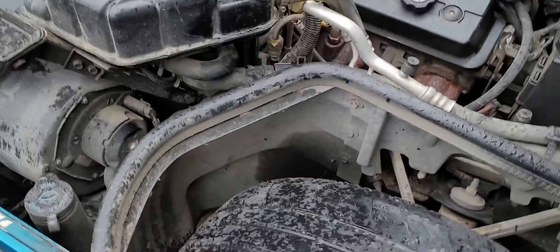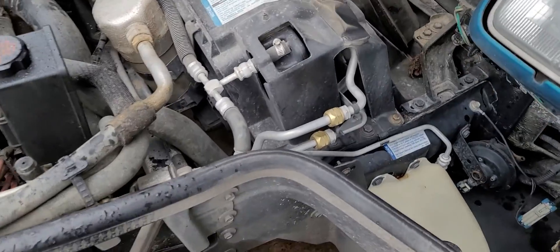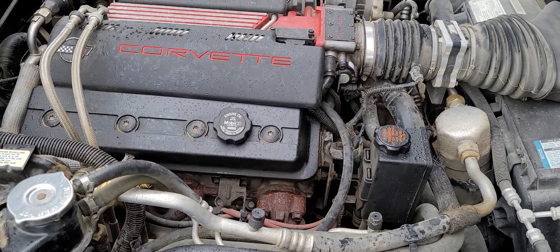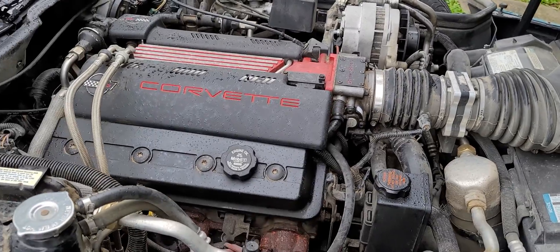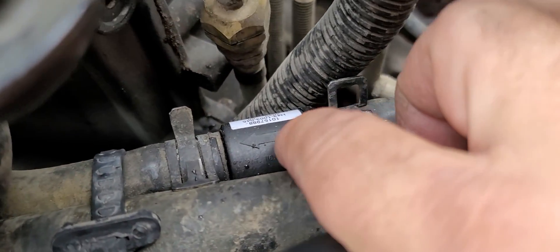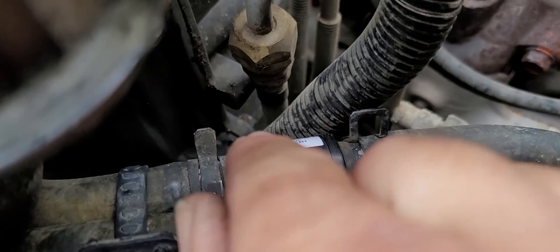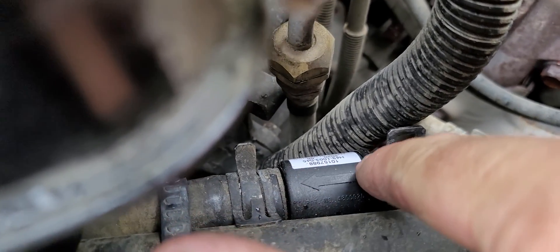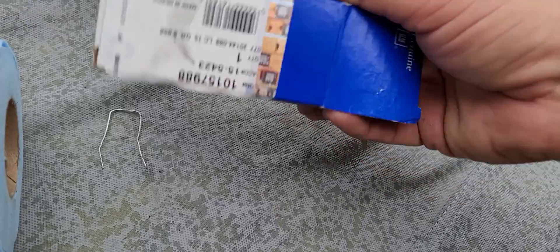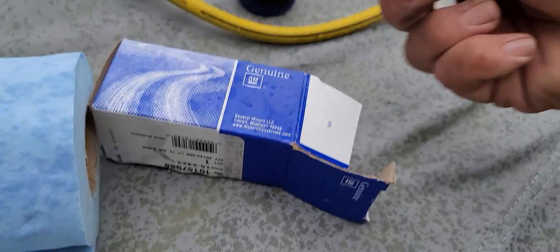I ended up on the cooling system today because I had a small failure. When we were running the car and it got up to temperature, we had a symptom where coolant was boiling. Sometimes that can be a head gasket issue, which obviously is not something you want because it's not easy to get apart. However, what I was able to see was this little tiny piece right here - a one-way check valve for the heater. It keeps coolant from going back the other direction, and it had actually fractured right on the seam and was leaking fluid.